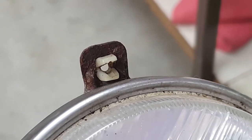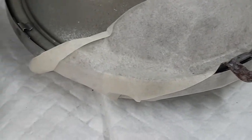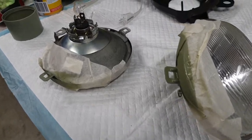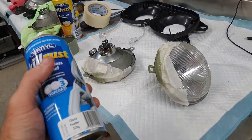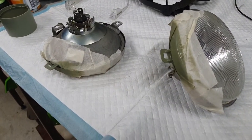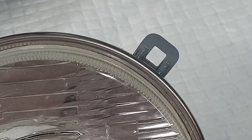The rusty parts of the headlights started out pretty rough. I treated them with the Ranex so now all the rust has been neutralized. I'll paint them with rust-proof paint. They've been primed with the rattle can and now I'll put the paint on - I'll use this pewter stuff because it's not black and it'll disappear in the headlight area, plus it's what I've got kicking around the shed. Now that they've all been painted I'll put them into the headlight housing.